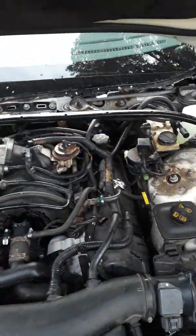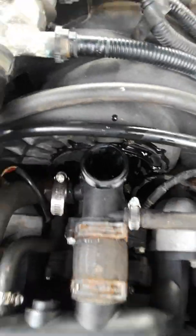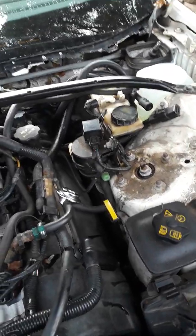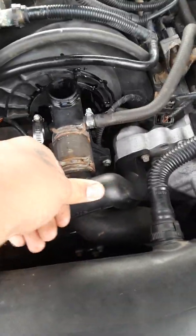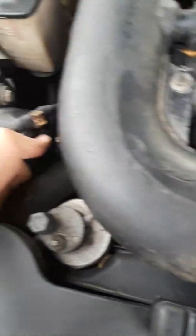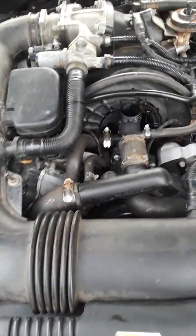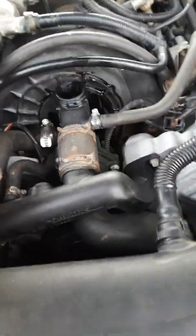Filled the bottle, tried bleeding it, but it wasn't going straight through. So remove this cap and fill that. As I was filling it, I could tell it started to overheat — the bottle was full but coolant wasn't going down into the system. Came over here, this was still a little warm, but the hose over here was cold. You can squeeze that hose — as you can hear, that'll push coolant around in the system and push it to where it wasn't getting to.